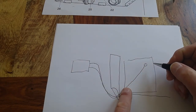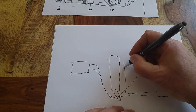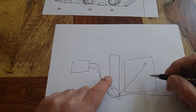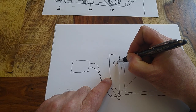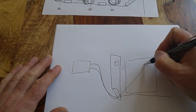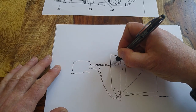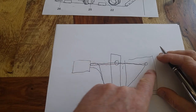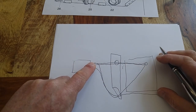This is why they've had to install that line at a 45-degree angle — because if you put it horizontal it's going to kink here and kink here. So what I'm going to do is drill a hole right there, about an inch and a half, and go straight across right to the top of that radiator. My line won't go up and down like this — it'll go straight across, and that means I won't trap air there in the first place.